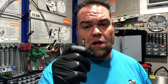On today's video I'm going to show you guys how I remove the oiler pump on a Stihl chainsaw. Each different saw is going to have a unique oil pump to it. The one I'm replacing today is going to be the smaller version commonly found on your 170 and 171 saws. On the bottom of the oil pump it's going to be threaded, and those threads are what's going to help you extract this from your saw.